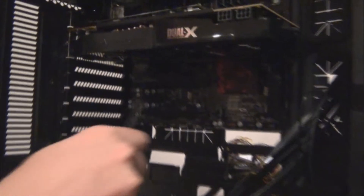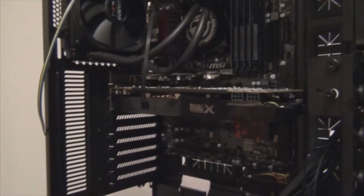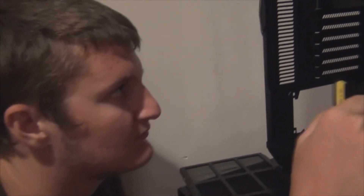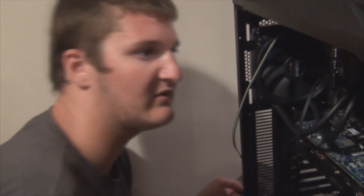For many different cards, if you're doing a crossfire configuration, you'll want to space them apart — either go in the second slot down or the third, and use your crossfire or SLI bridge to connect the two cards. In the next episode we'll be covering power, plugging everything in, and getting the power supply installed. I believe that's all for the components — we'll see you in the next part.